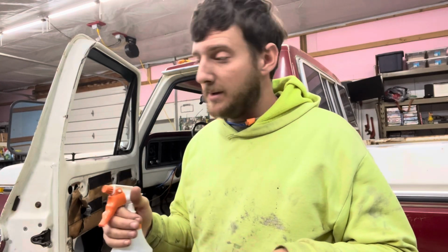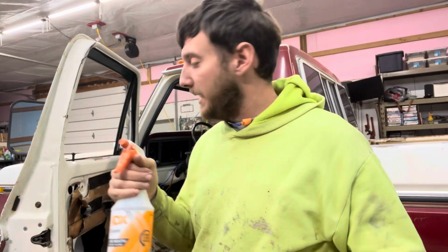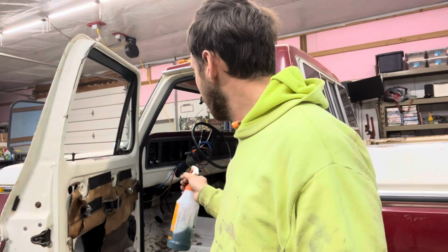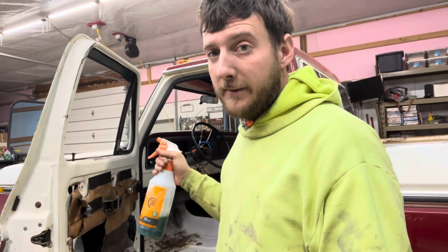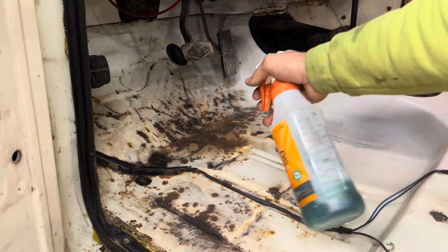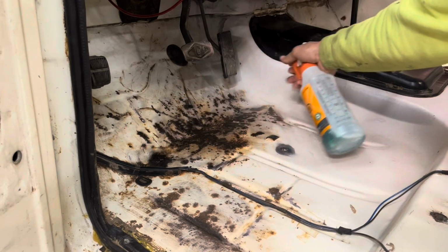You don't want to have a bunch of debris and dust and rust dust in particular. You want it to be pretty darn clean. Then spray this on. This is the active agent in POR15 and many other Rust-Oleum products that inhibit rust. So I'm gonna spray this on and it's gonna turn black after maybe 15 minutes. Thermometer says it's 40 degrees in here, so we're gonna give it some time. Let's see, just a little misting action going on.